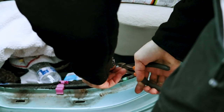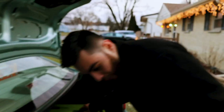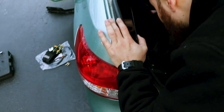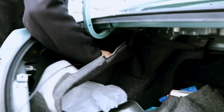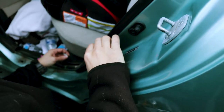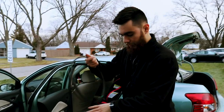It's a pretty thick line that might not cut easy — I don't want to cut anything. If it doesn't come out though, I'm going to cut it. Let's pull off a couple more of these panel clips so we can get a better view of what's going on over there. Make sure you don't lose those — you're really going to regret it if you do. It's a different type of panel. Also the side over here has this weatherproofing and that's adhered on. Want to make sure that the line is the same size before we go through the pain of fishing it through and then find out it's actually the wrong part.